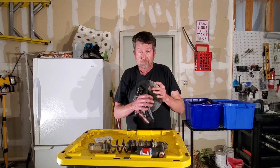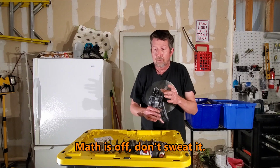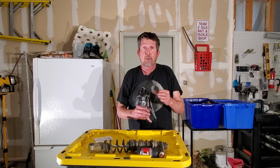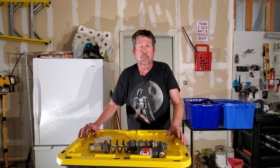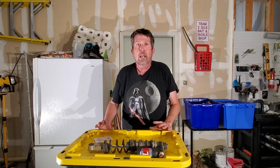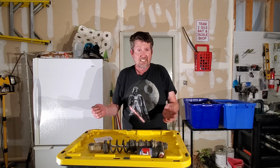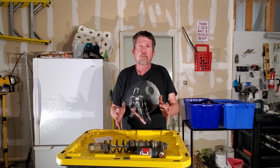Now you're up in there about 5 inches total right now of 8. So now if it goes back out again, that's going to get you to 6. That third bump you hit again, boom, you're bottoming out on that next thing. So that's actually called your shocks are packing up. They just start compressed and then it slowly comes back out. What happens, it just keeps doing this until it finally gets compressed, then you have nothing. That makes your bike ride really rough. That makes you think like your compression is too stiff because it's got a really rough ride to it, but it's actually not your compression. It is your shocks are packed up there from having the rebound too tight.